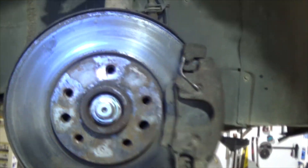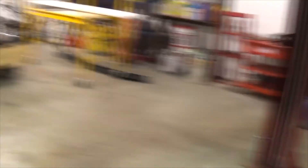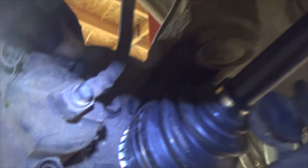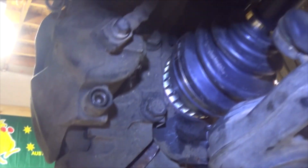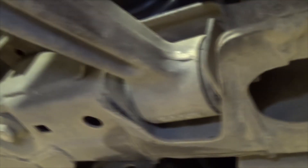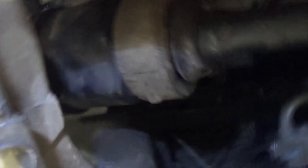Now we'll put the brake mounting bracket back on here, unhang the caliper from the coat hanger, put the wheel back on, drop it and she's ready to go. Yee-haw! Alright, I'll button it back up. Oh, I've got to put those two little dust caps on — keep all the grime out of those. Allen head. Now she's all buttoned back up. Double checking everything.